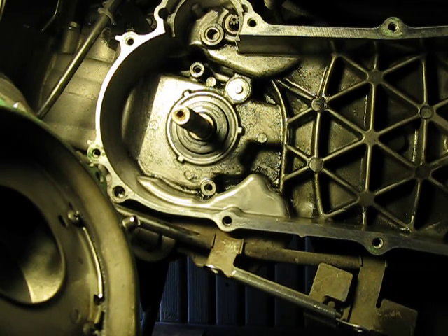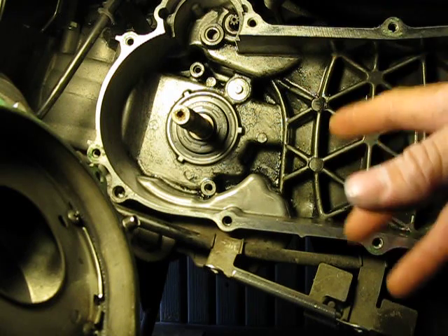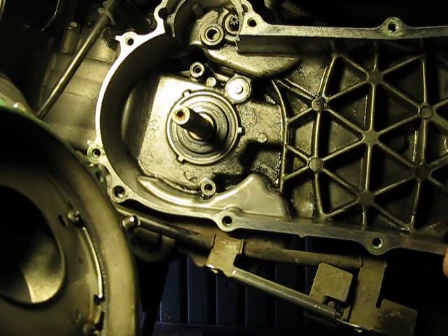So I've definitely overfilled this thing a bunch of times. When you just barely overfill it, it's not so bad, but that time I made it half an inch higher, that probably caused the most leakage. When you have too much oil, the pressure builds up inside the crankcase and has to go somewhere, and the crankcase ventilation can only do so much — especially as RPMs build up higher and higher.